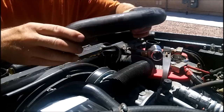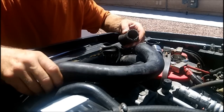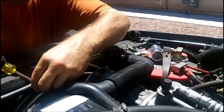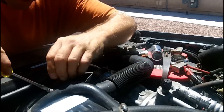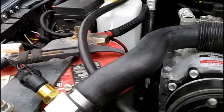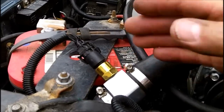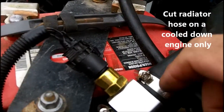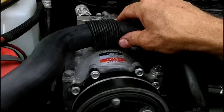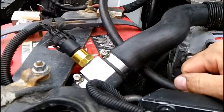On the old install I still have the old radiator hose and I'm just going to reuse it — take this one off and replace it with the one I've already cut. You are going to lose some antifreeze. Installation of the adapter is pretty simple: you've got your upper radiator hose — this is the hot water coming from your engine block and head — and you simply cut the radiator hose. You could remove an inch of the hose if you like, but you can also just cut it and push the radiator hose back so it sits a little further back. If it seems like it's kinking at all, remove approximately one inch.